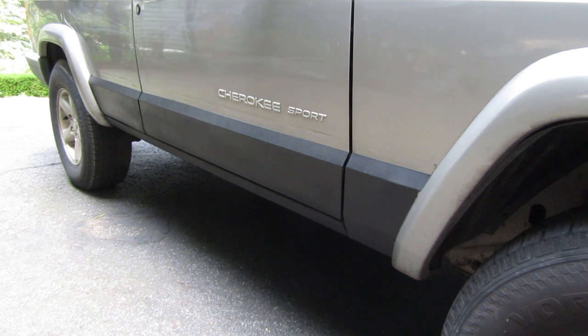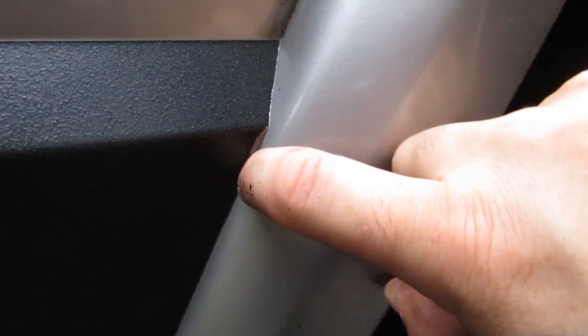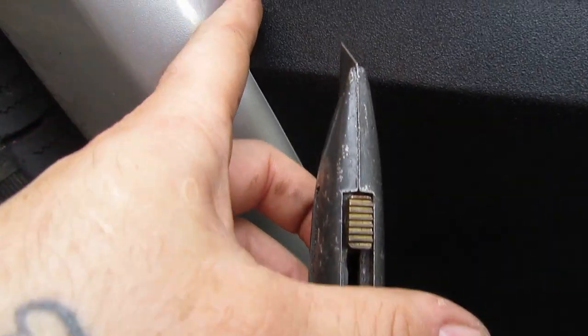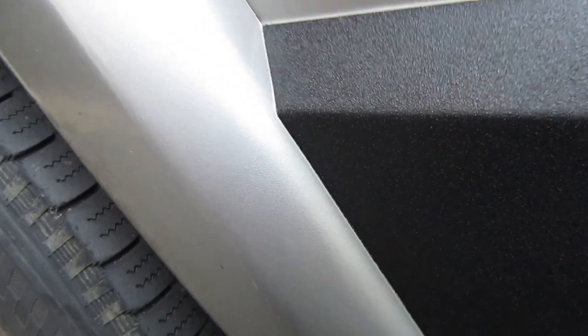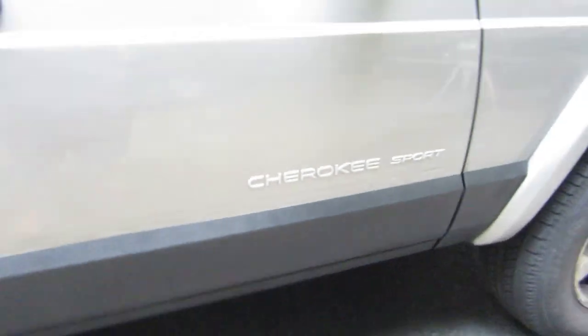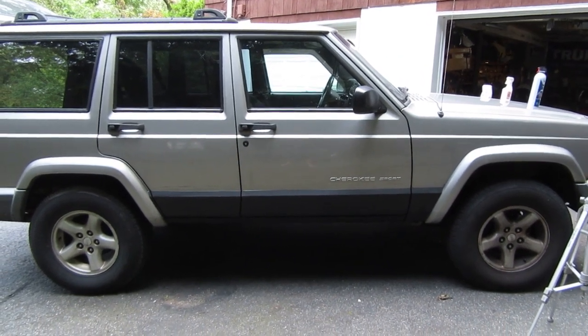I had a small problem with peeling. I think maybe it's above the humidity level it's supposed to be for spraying this stuff. It wasn't huge, but I did have some areas that I wasn't super happy with. You can see right here — it started peeling when I pulled the tape away. I'm going to try to let it dry completely and then touch it up. Pro tip: on the other side, I used a utility knife to score the paint right along the tape line, like you would with latex paint in the house, and I got much cleaner lines. So treat this Plastic Coat almost like a latex. Other than the little peeling issue, I'm pretty happy — it's got a really nice textured look. It wasn't super expensive and it cleans up the Jeep a bit and certainly will help protect my rockers and lower doors from road salt and crap in New Jersey.